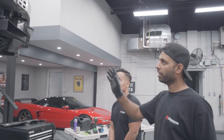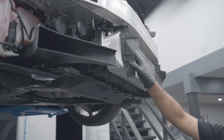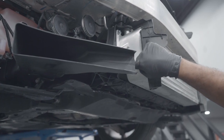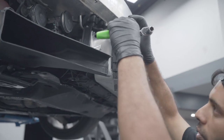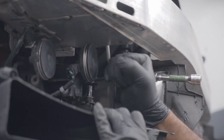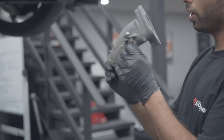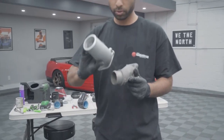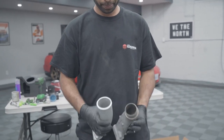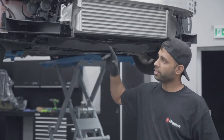We have the car up in the air but we'll keep the same tools. In the front of the intercooler, since this has been swapped out already — if you had a stock intercooler these would be 12mm or 10mm bolts. Now we have 8mm or 6mm allens. With the dual horns, crack that loose. With that inlet pipe — or sorry, hot charge pipe — we pull it out the same way we had that rubber pipe come from. The sizing is not too different on the side where it meets the intercooler, but there is a size difference on the other end.